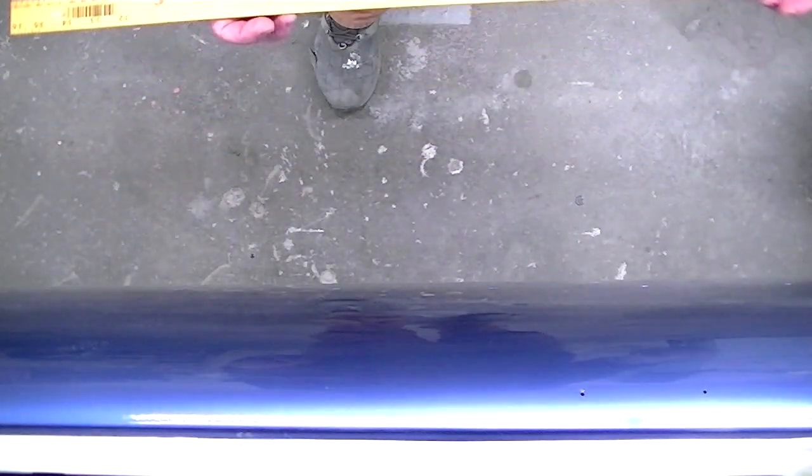Now if we look at the hood of the car, we can see a whole bunch of gapping boards that I made for the hood, the fender, and we can look at how that worked out. The cowl and the hood fit perfectly. The fender and the hood and the cowl fit perfectly. It's all due to the usage of the gapping board and leveling the panels to one another. This is a technique that really brings beauty to the car.